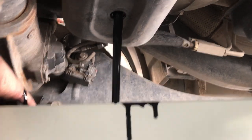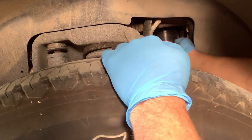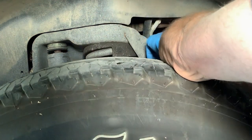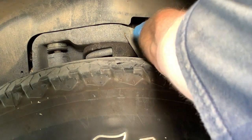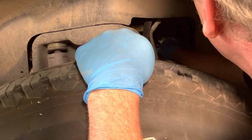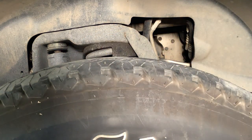We'll let that drain out and get to the oil filter. You can see back here — this is the oil filter we're trying to get off, and it would actually come through here but only sideways, not in a vertical fashion. So we're going to put our oil filter wrench on there. Because the oil was so black, I thought I'd grab a pair of gloves — this is my first diesel oil change. I think we got it loose enough. Once you get it, you can lower it down partway and it'll sit on a frame member in there, then pull it out. Not one drop spilled.